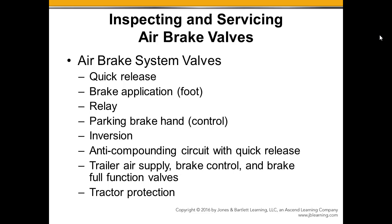The park brake, the push-pull — there's a test for that to make sure it's working, as it has another high attrition rate. So again, listening for air leaks at the exhaust and all that. An Inversion Valve that starts to operate the spring brakes when we start losing service brake pressure — there's a test in the systematic test that will test that Inversion Valve.